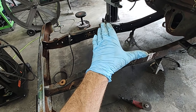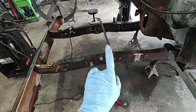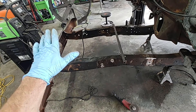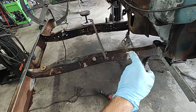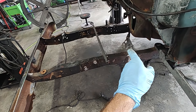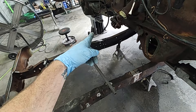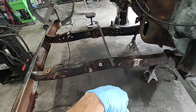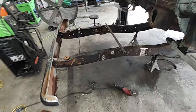At this point we're going to throw some jack stands under here to hold this so it doesn't drop. Get your jack set up in the front so this doesn't slam to the ground. Then get your grinder and cut this right here. I'll leave maybe the top here and then jump to the other side and cut it. When I get to that top, I'll go ahead and cut both — that way this one isn't just dangling around the whole time.